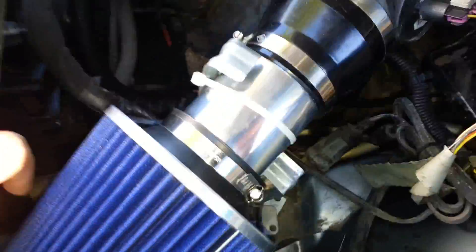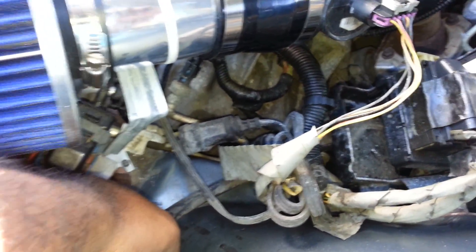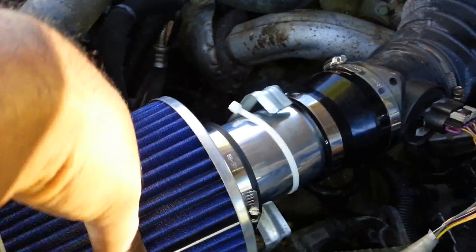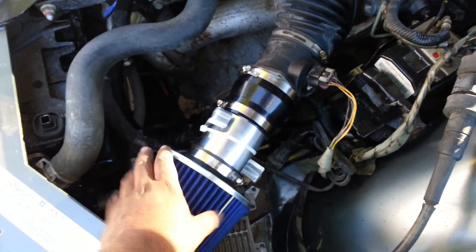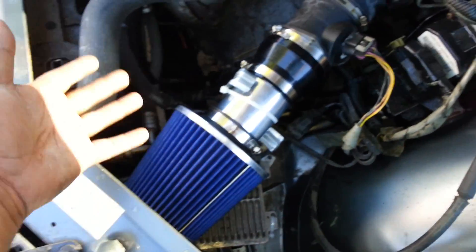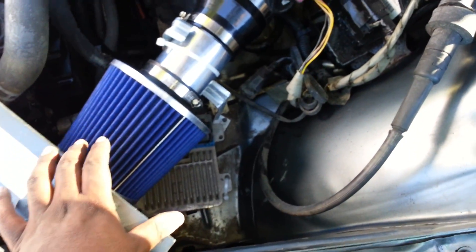So what do you do? I fabricated a bracket right over here - it's a metal bracket I self-tapped right into here. This was a straight bracket that went up so I used my clamp and bent it over here, and bent it over here with a little extra to hold it and secured it on. Not as nice or beautiful as I would like, but from far away you can't really tell, and it secured it so now there's just a little bit of play as there should be - no worrying about banging the ECU, hitting the rad hose, or getting loose over time.